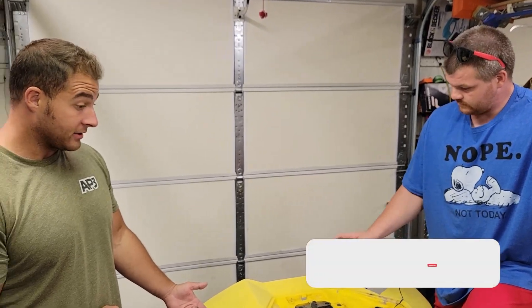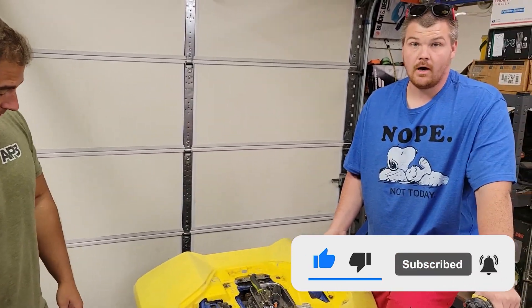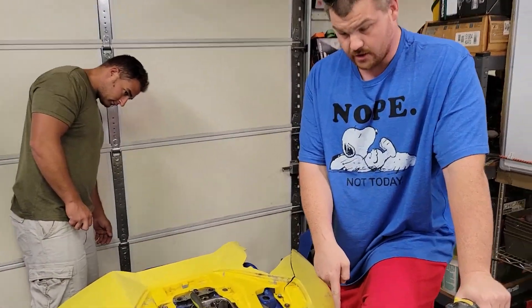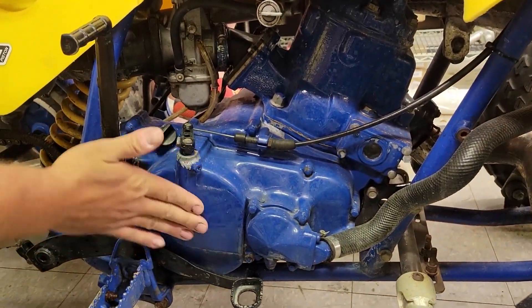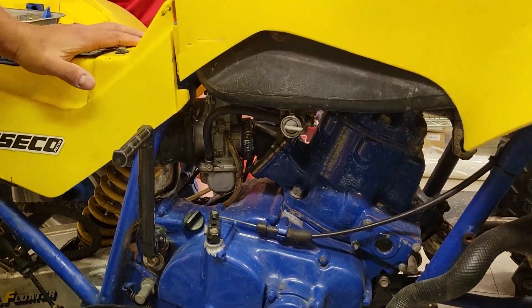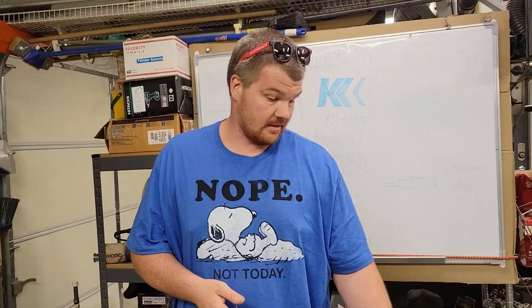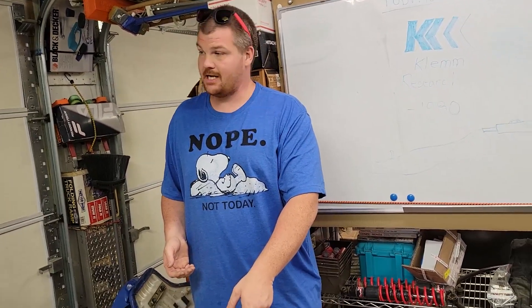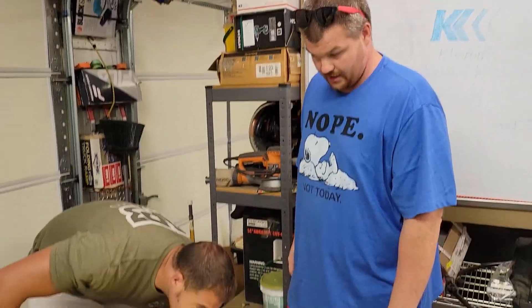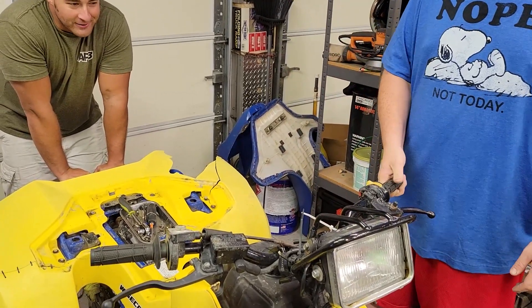You're looking at new plastics in the back, correct? But the rest of this machine is actually pretty tight. It's a really nice quad - looks like they went over it. Everything looks like it was freshly powder coated maybe a year or two ago. Apparently the guy who had it before redid the entire thing from the ground up. There's aftermarket A-arms because the ball joints are swappable. The only thing that wasn't clean was a case bolt that snapped off for the case saver - super common when they wrap the chain. Steering stem is bent, handlebars are bent.